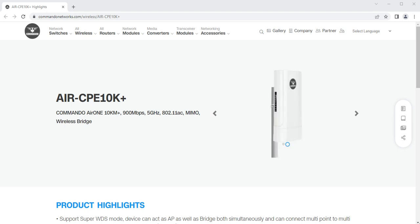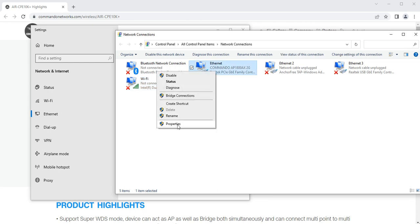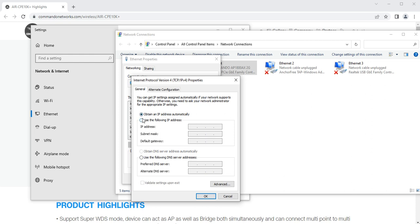For wired access via the LAN port, connect the PC. Power on the AR1 CPE 10K with a 12V 1A or 24V PoE adapter in the WAN port, which comes with the device. Connect the LAN port of the AR1 CPE 10K to the PC via RJ45 cable. Open the Network Sharing Center and go to the Ethernet option. Change the IP properties to manual and set the IP address to 192.168.188.1–252, subnet mask 255.255.255.0, and default gateway 192.168.188.253.